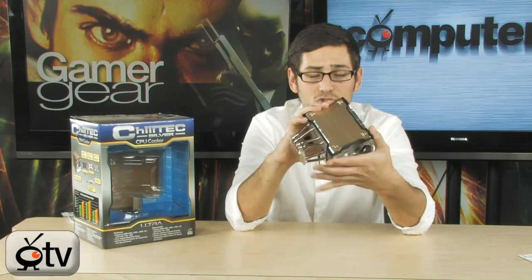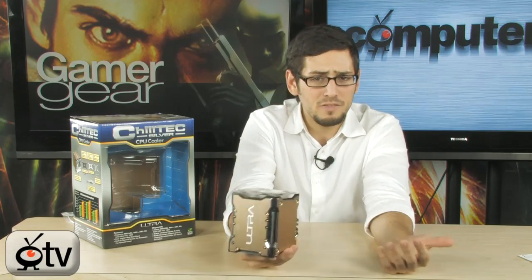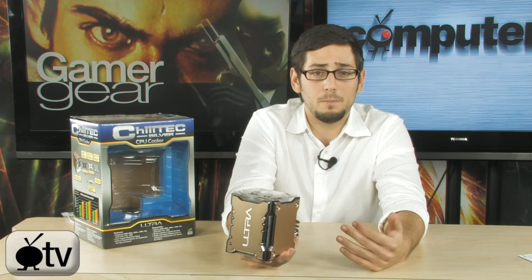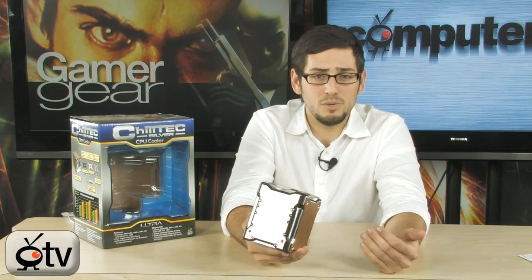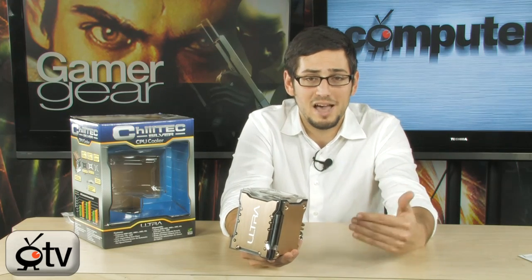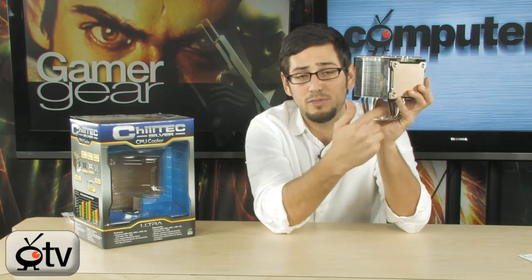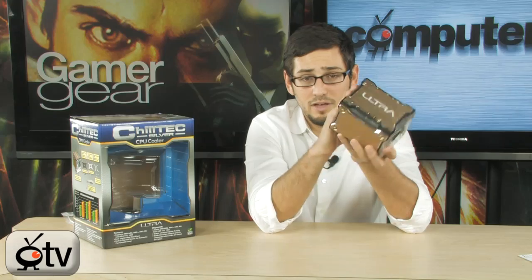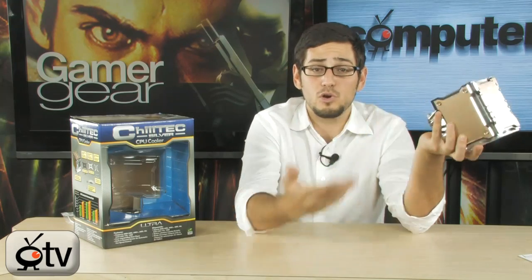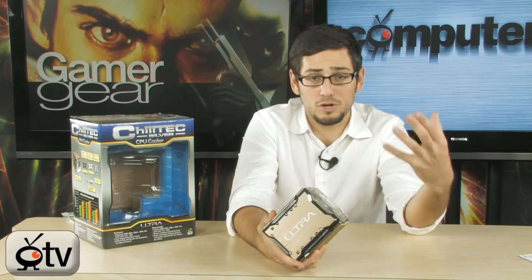There's no thermoelectric cooling — it's just a straight heat sink. People realized that the Chiltecs were really good CPU coolers, giving quite a good overclock and pretty good performance. But the thermoelectric unit wasn't turning on unless you had a pretty hefty overclock and high temps. That was because even going through the heat pipes, the cooler itself, the fins, and the fan were doing a great job keeping everything cool up to a pretty decent overclock. The Peltier wasn't being used unless you were doing more extreme stuff.